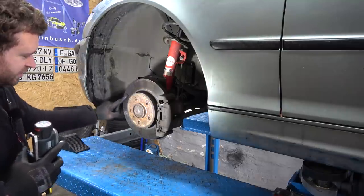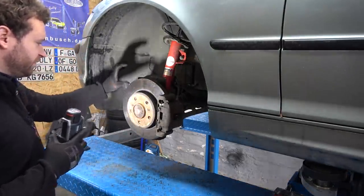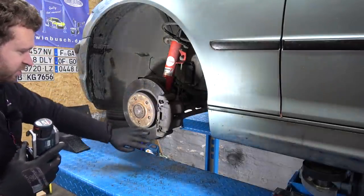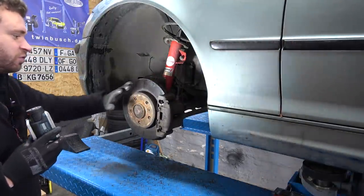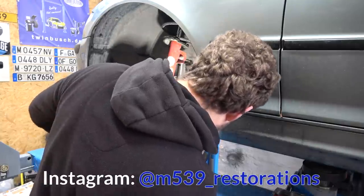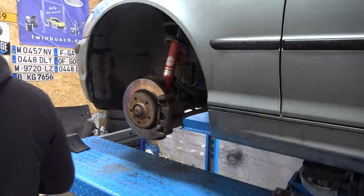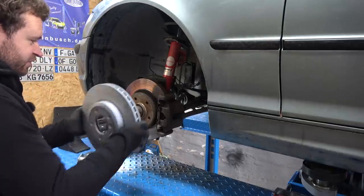Let the operation papaya commence. This brake disc is hot garbage — I don't know what brand this is, but judging by the state of it and the fact that it's not worn too much, it's something cheap. There are a lot of hot spots and whatnot. I'm kind of looking forward to removing this because it's also vibrating under braking. This is the 325i caliper — the smaller one — it's working fine, but we need bigger brakes.